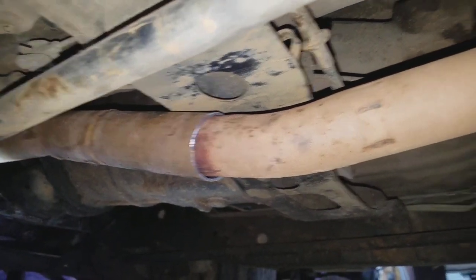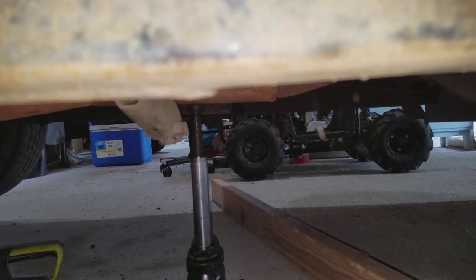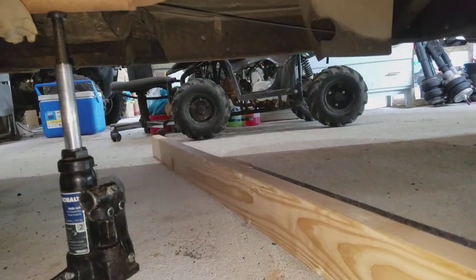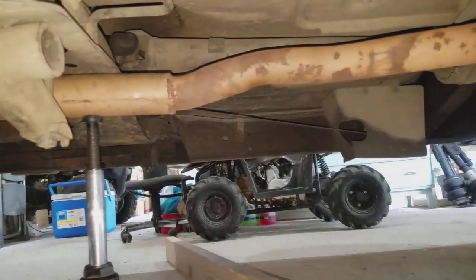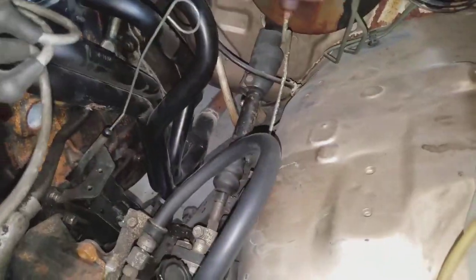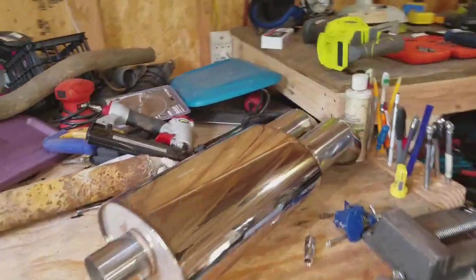You're building this to lay out on the ground so you need to get everything level. I'm going to take a two-by-four and run it from frame rail to frame rail so I can make sure it's not going to be below it before I tack weld this in place. Then I can pull this out of here and weld it up the rest of the way. The other piece is on there, up underneath there, and it's welded all the way up to the back of the cab.